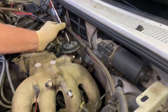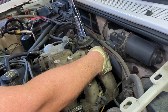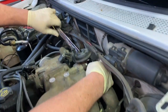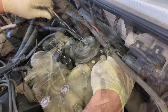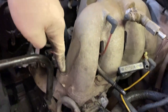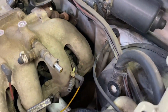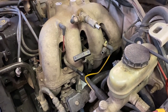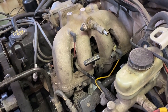Using a 1-1/16 inch wrench, I'm breaking loose the EGR tube going into the EGR valve — a little harder to get to, but got it broken loose. With the EGR tube removed, we start taking the upper intake off. There are bolts here, here, here, here, and one underneath the EGR valve. These are 13mm — I'll probably need a swivel for some of them. We're going to break all of these loose and pull the throttle body and intake off as one assembly.